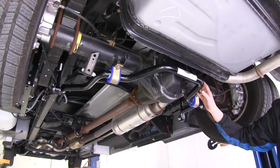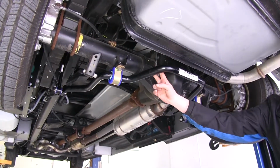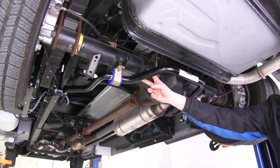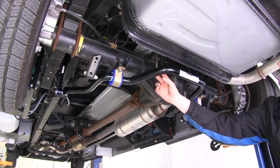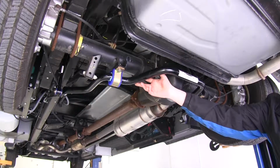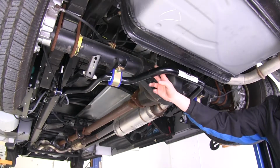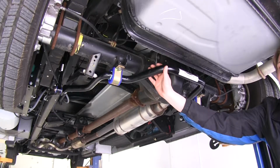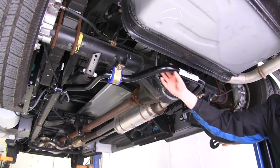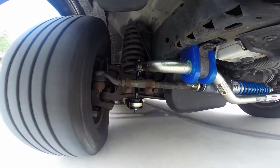We're now back at our rear axle, taking a look at the rear sway bar. While this is an option on most factory vehicles, it's not going to be as robust like the one we got here from Roadmaster. Typically when your vehicle is built, it doesn't have all the RV equipment that's on it from the factory. So that sway bar is not up to the task once they add in all those luxuries. The one we've got here is considerably thicker and able to handle that task.